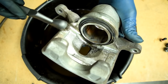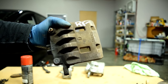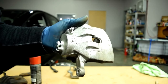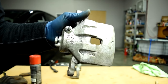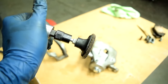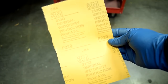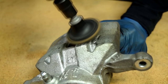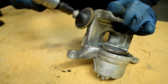Just make sure you go easy around the boot for the piston. Before we start spraying, we need to get the caliper down to bare metal. Normally your caliper might have a little bit of rust on it, but the caliper for this Elantra basically had a powder coating of some kind on it, so we need to sand it down to bare metal. If you have an air compressor, you can use an angle grinder with a coarse sanding disc, or a Dremel tool with a wire wheel, or some sandpaper — either 220 or 320 grit would probably do. I used the angle grinder in combination with the Dremel tool to get into every nook and cranny and get the caliper down to bare metal.